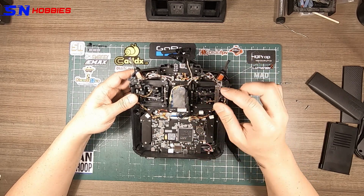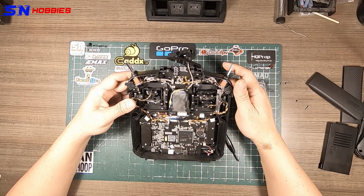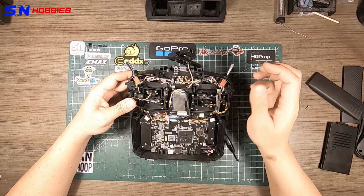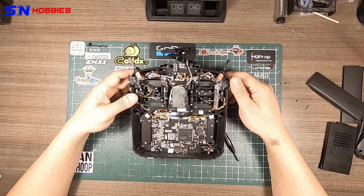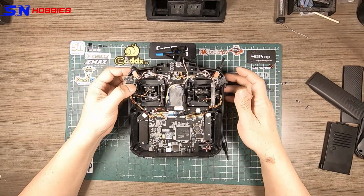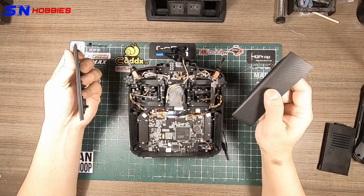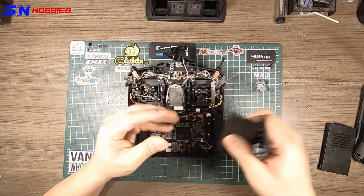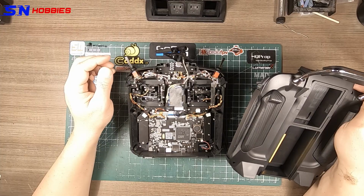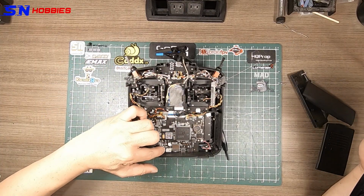So yeah, this is the internal module for those different protocols. LCD. Yeah, it's pretty clean. So yeah, 4 screws, 2 hex screws if you need to pop it open and adjust that. Pretty easy, and make sure that you remove this, because it took me a while to figure out that I need to remove this in order for this whole back part to pop out. And make sure you remove the battery, because it is actually connected there.